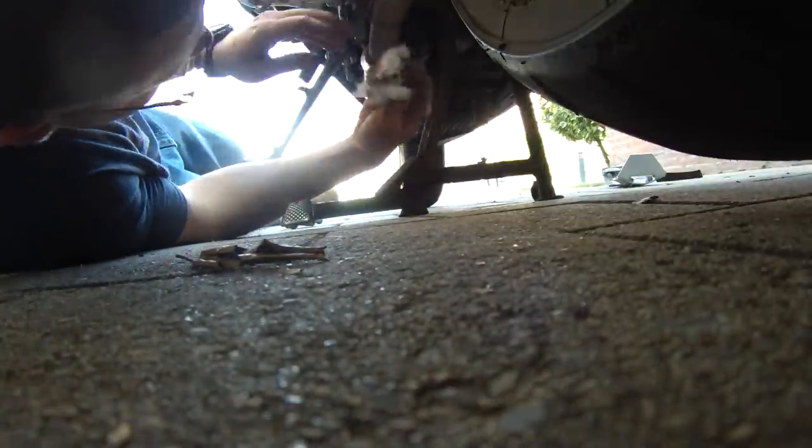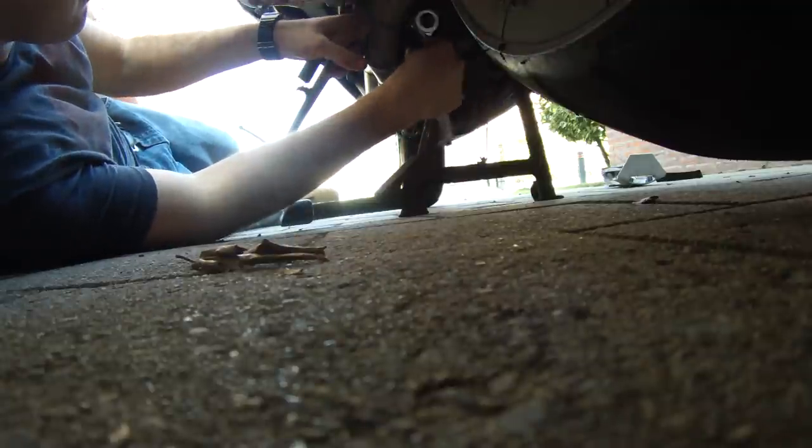Not a drop spilled! Well, it did get a little bit on the exhaust — sorry about getting excited. But when you go to do this on any vehicle, car, motorcycle, whatever, you'll understand. If you've done it before, you definitely understand. Your oil filter doesn't really need to be any more than hand tight, but with that nut on the back of there it really helps get you those extra last couple of turns.